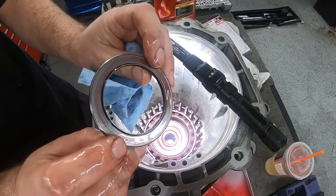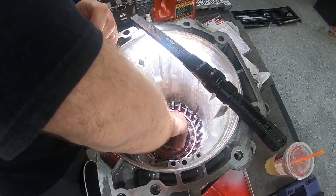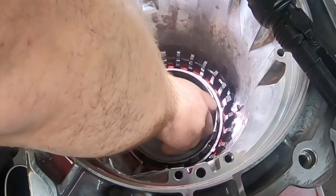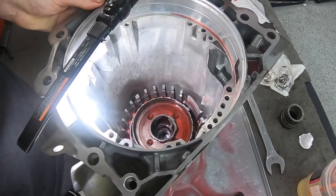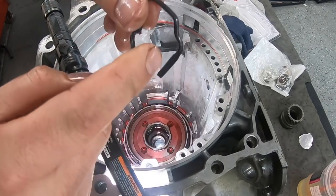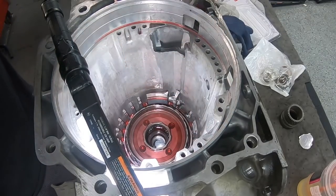The larger thrust bearing sits between the planetaries and the ring gear. There's a little lip on this - when you put it in, make sure that lip faces into the case because that's going to kind of lock it in place. Before I forget, the anti-clunk spring - there isn't a perfect place where this sits, but it goes right here. You can see there's kind of a curve in the case, and we want to drop the spring in so the flat end is sticking up and the curve in the clip lines up with the curve in the case.